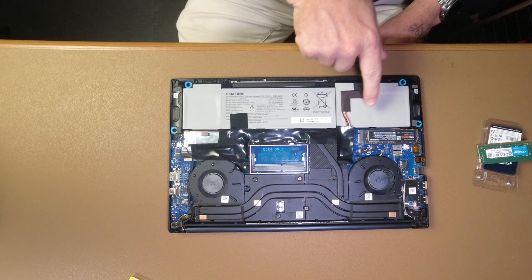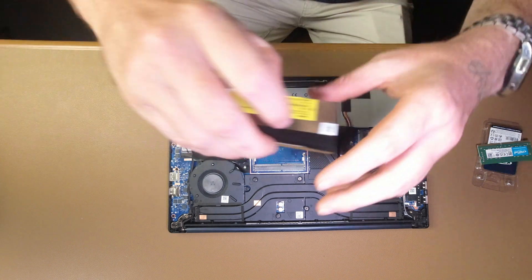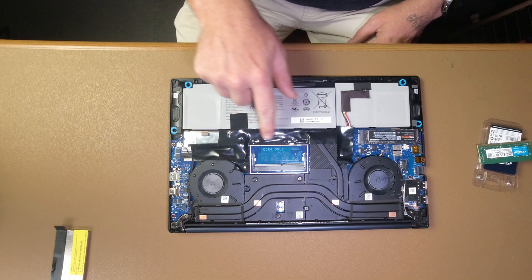It's a little tricky — well, not tricky exactly — but as y'all know I already burned up my computer once attempting to do this, because it has this little metal case that goes over it. It clearly says before you replace, unplug the battery and unplug the main power, and I can't seem to find the main power anywhere on here. I think it's because Samsung doesn't want you doing it yourself. So I found a solution: I went ahead and put electrical tape right here on all the connectors that surround it. Last time I dropped the metal case and it touched something on the board, smoked, and that's what ruined my motherboard — I had to send it off to get it replaced. So I went ahead and put electrical tape over anything I could possibly touch with that metal case.